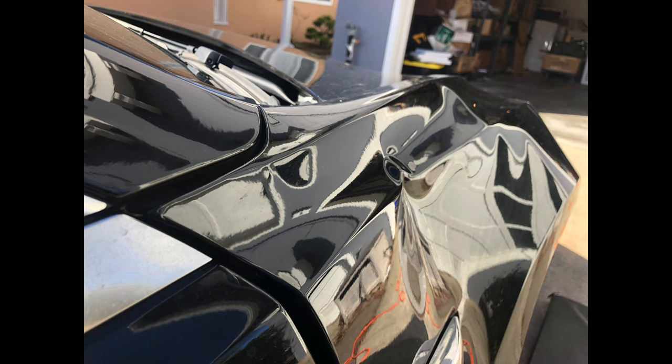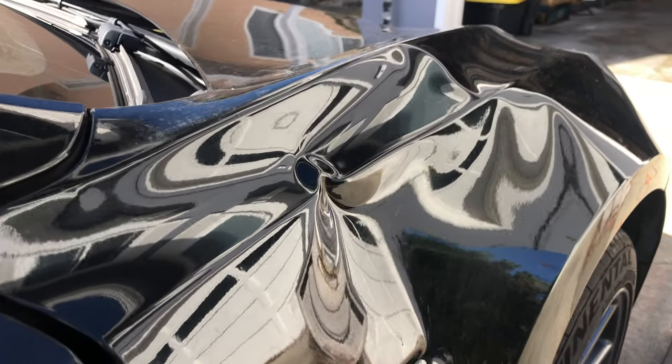When you do jobs like this, you do it for the customer who wants it done. This particular customer really understood the value of his factory paint and finish. The clear coat on this vehicle is as strong as a cell phone cover. The paint isn't sprayed on — it's applied by electrostatic process, so it's literally like a piece of plastic over the metal, cooked on. It's irreplaceable. A traditional auto body shop has to replace this piece entirely, and when it's painted again, the clear coat is not cooked on at high temperature — it's just sprayed on and cured.